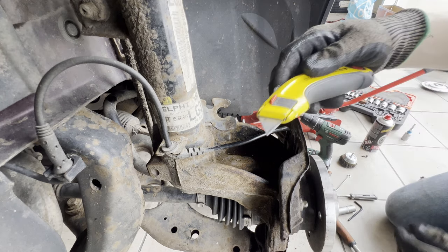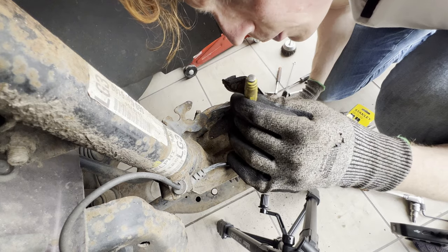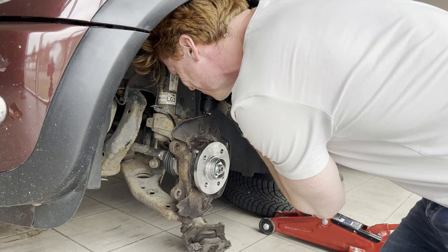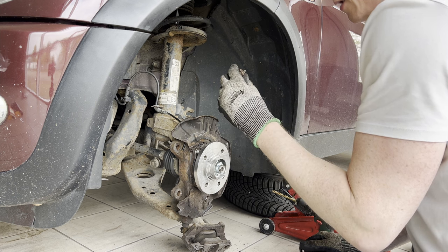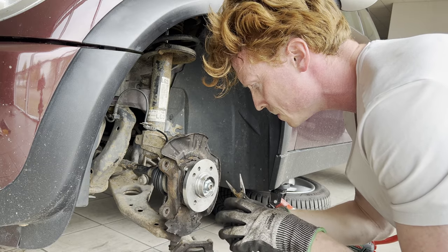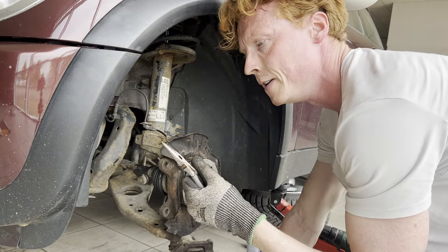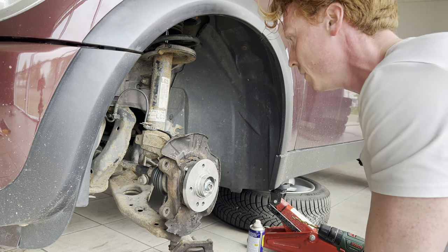What I'm gonna do — I'm gonna cut the cable, and then we're gonna drill out the whole plastic sensor. First with a punch we're gonna punch a hole, then with a small drill bit we're gonna drill a hole. Look at that. So a small update on where we are: loads of plastic debris. The plastic part that would need to be removed too. Look at that — yes! And that was the last piece. So that was a relatively easy five-minute job. Now we're gonna continue with the cable management of the ABS sensor.